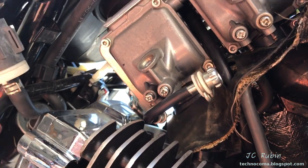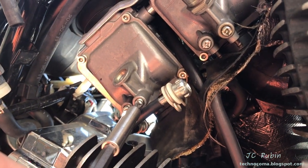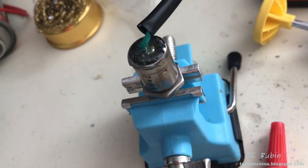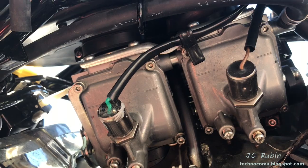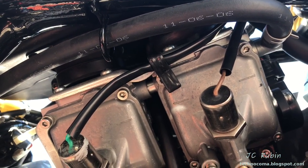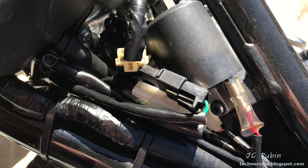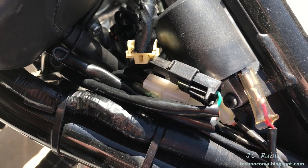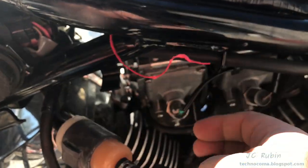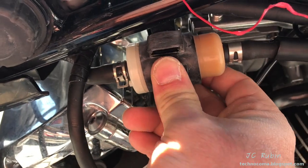All I've got to do is get the solenoid back in for a separate project. Make sure one last time that the drain screw is completely closed. This repair has been completed — I have a new epoxy cap drying over that repair, and the solenoid is going in as part of this action. I've repaired and reinstalled the solenoid, pushed the wire back through the wire harness on the back carburetor, and the cables are now coming through the top again where they've been reconnected. This completes the carburetor work.